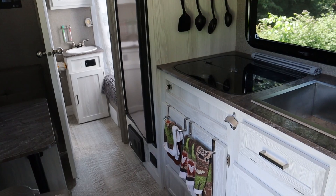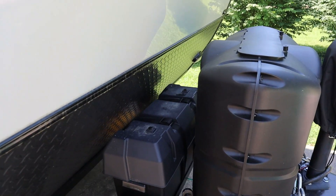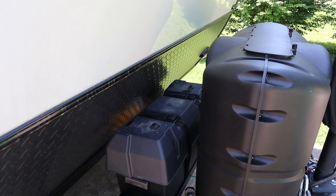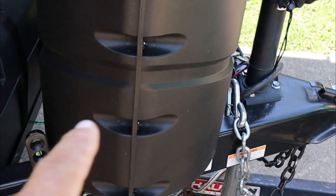The other kind of system we have within the camper is the 12-volt system. You'll either have one or two batteries — you could have lithium, AGM, or in my case these are flooded batteries — and that gives you your 12-volt system. When you're using the camper, there's a key behind your tongue on the other side. That key is your cutoff; if you don't want any power being drained from your battery while traveling, in storage, or sitting in the driveway, you turn that key off.